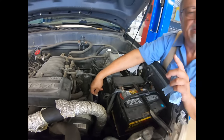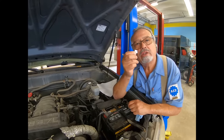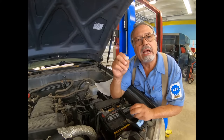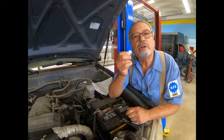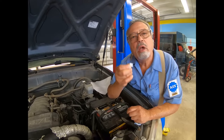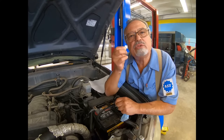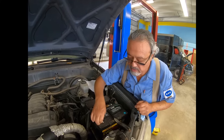Too small, we don't want it to get pulled in. Too big, we don't want it to get pulled out. Sometimes we have to put a little extension. What we're going to do: find the dipstick, take it out, wipe it down, put it in a safe place, practice putting the little piece of paper over the tube — and then we're going to start the engine. I have to tell you everything ahead of time because the engine gets a little noisy. With the engine idling, I'm going to take this piece of paper and put it on that tube. Guess what that paper should do? It should stick. There should be a slight, subtle vacuum on this.